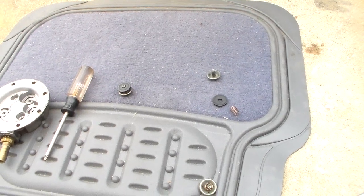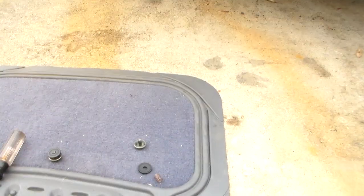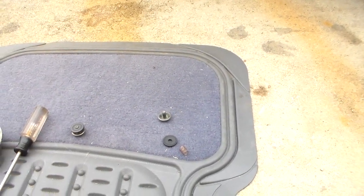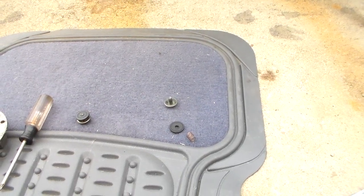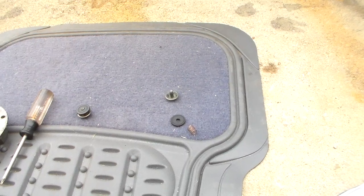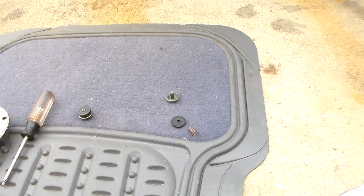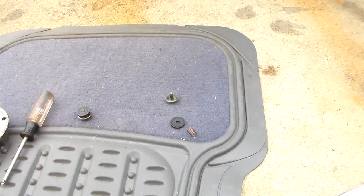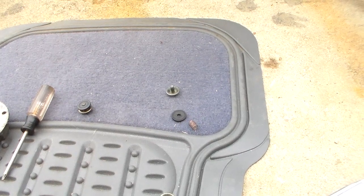Regular pumps, like any other car mechanical pumps, they have check valves also. But usually those pumps you can't really do anything with them if they stop pumping. If you think it's a check valve sticking, you can try to blow back through it with an air line and try to put some force in it. Sometimes you can unstick them. So you can try that first before just throwing it away and condemning it.